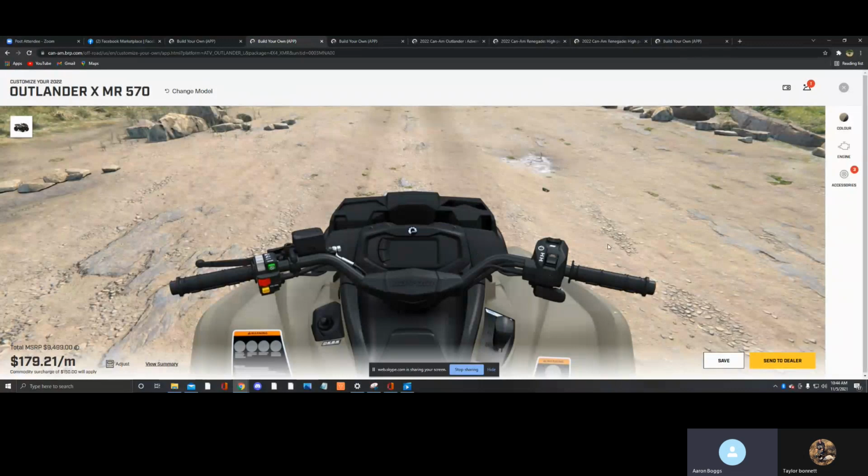The problem was that back then I didn't really know what I was doing. That's why the bike got destroyed. You just have to know what you're doing when it comes to doing clutches, because that secondary is very, very sensitive. On my other 570, I had a CVTech primary with different weights and stuff like that in it. And that's what I have on my 850 now as well, and it does a super phenomenal job. I've had literally zero issues with it, and it really does make a difference.